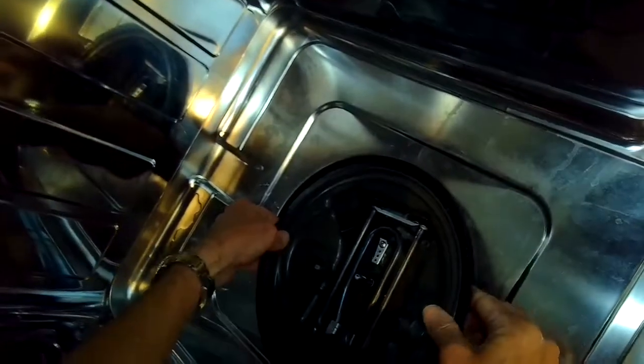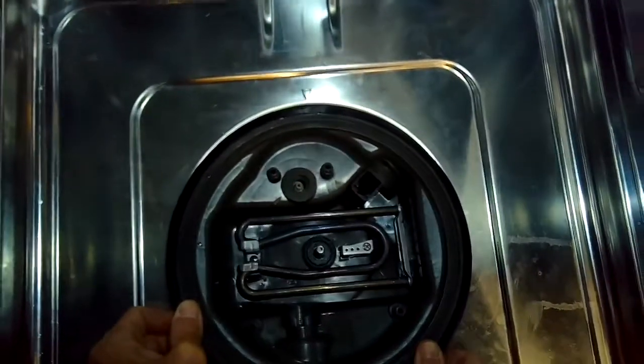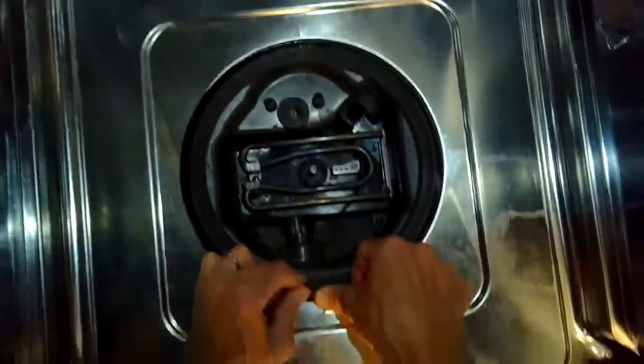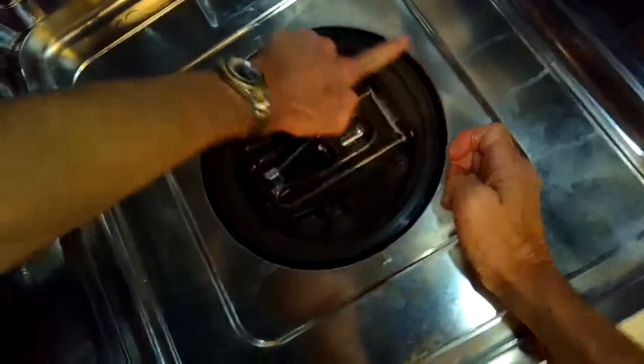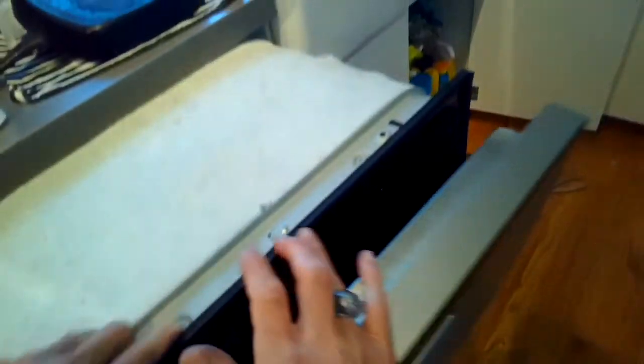You'll notice that the drain pump is to your right at about 45 degrees. Push in the whole sump assembly at the 12 o'clock position first, push it in securely, and make sure everything's straight. The heating element is on the horizontal plane facing you. Push down on the seal to make sure it's totally flat — if it's raised at all it'll leak. Then put the dishwasher on its side again, connect everything back, and you're done. That should get rid of the leak.